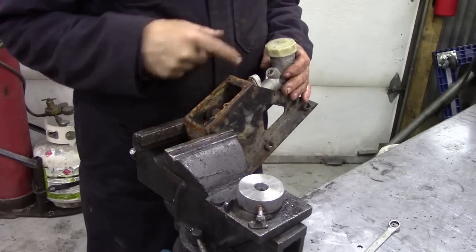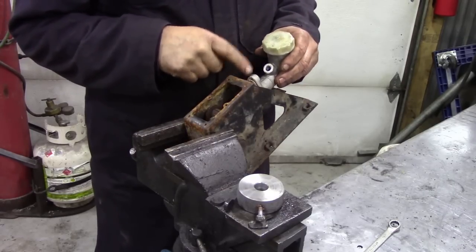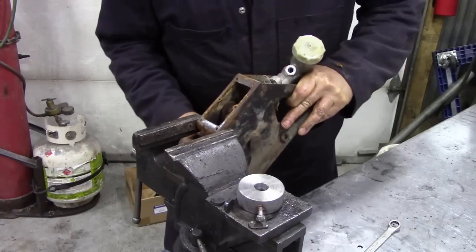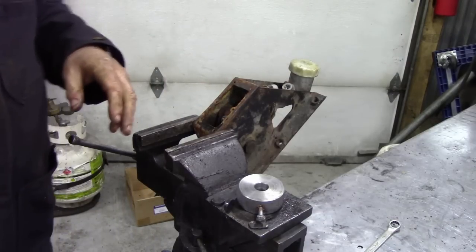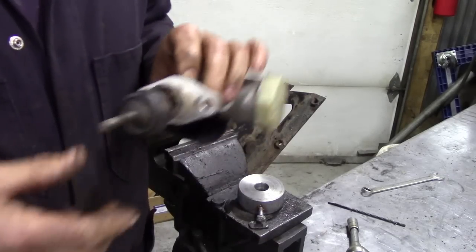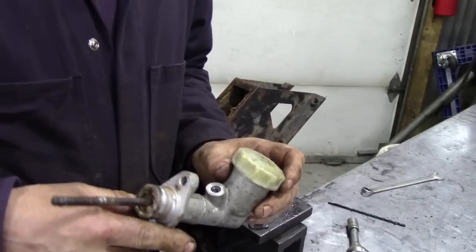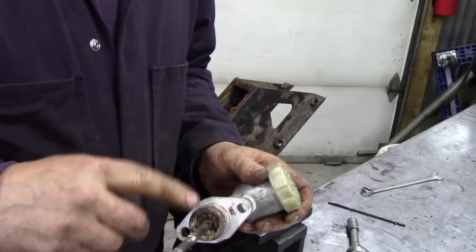If you find out that the shaft is seized up inside the cylinder and it won't move, just simply undo these bolts first and this will allow the pedal to move backwards and forwards so you can get to the adjusting bolts. You don't have to do cutting and grinding, you don't have to be brutal. So I got the cylinder off and as you can see it's seized up — the piston's seized up. Sometimes you can buy seal kits for these. I've actually done it myself only when the bore is perfect, and even then I'll only put genuine Girling seal kits in.